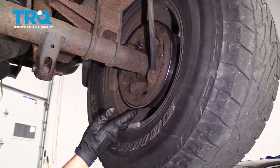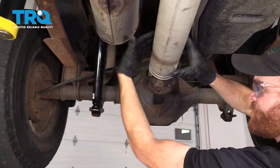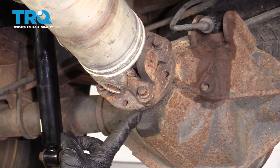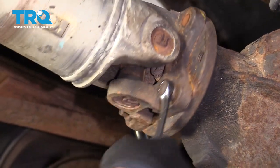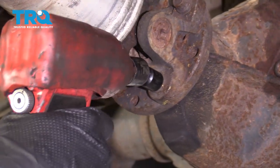Once you get it so the drum can spin freely, let's do the same to the other side. At this point, what we should be able to do is grab onto the drive shaft and spin it freely. The next thing we need to do is go ahead and remove the drive shaft from this area. To do that, you're going to find four mounting bolts. If you're trying to use a ratchet or a wrench, this is going to try to spin on you, so you can just try to hold it with a pry bar or anything the like.